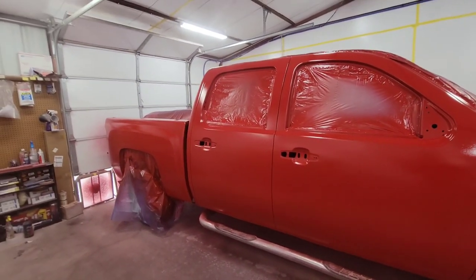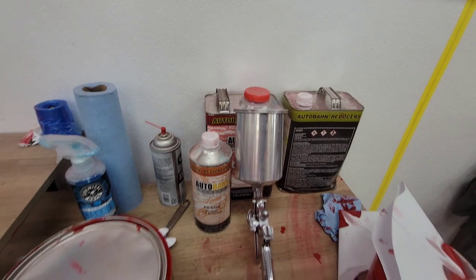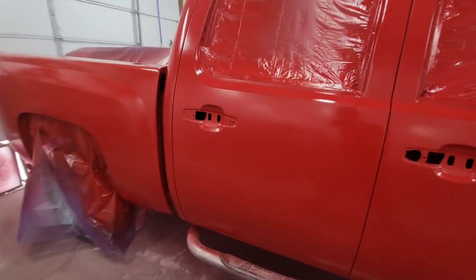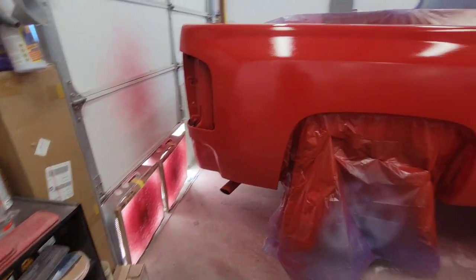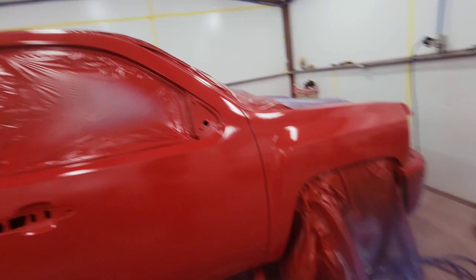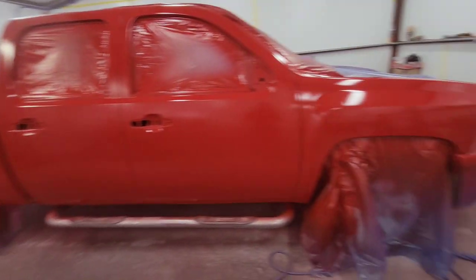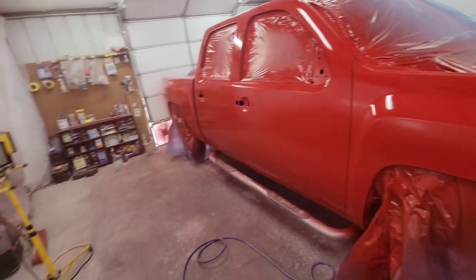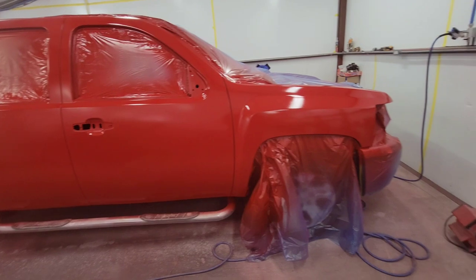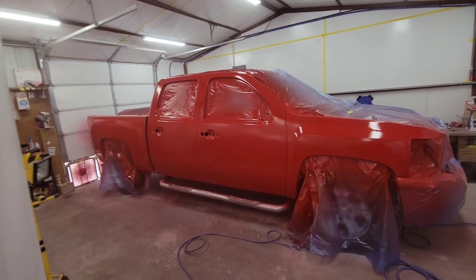Oh, we actually finished the paint right here. I could have mixed just a little bit more, but pretty good. I'll probably add just a little bit more just to finish one last pass for the top at the very end. But 18 ounces did this whole side, which was, I guess, 9 ounces of base, 9 ounces of reducer.